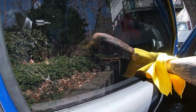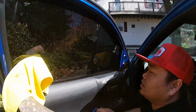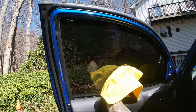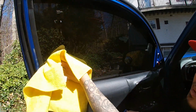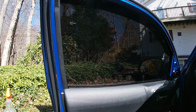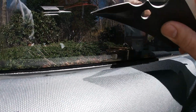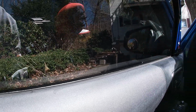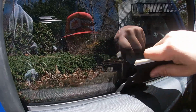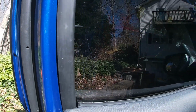Let's do inspection. When you think you're done, you wanna wipe it down like this, right? Wipe it down. Oh, I see a finger coming up. You see this finger? Come look close. See that? That's what we call a finger. Push that down. Good thing we're sitting under the sun. The sun is drying up the film quick, curing the film onto that glass.